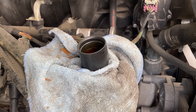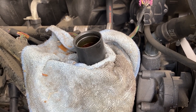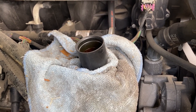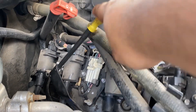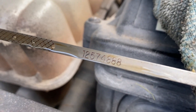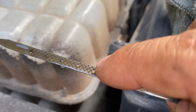After I finish pouring the oil, we're gonna go ahead and check the dipstick to make sure it's at the correct level. Make sure your truck is on level ground — if it's not, you're gonna get an incorrect reading. After you pour it, let it sit for a little bit so it can settle. The yellow one is your oil dipstick. You can see where it's marking — you want it right here, and it's right there — good to go.